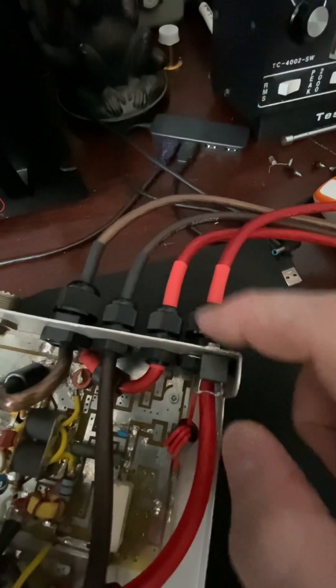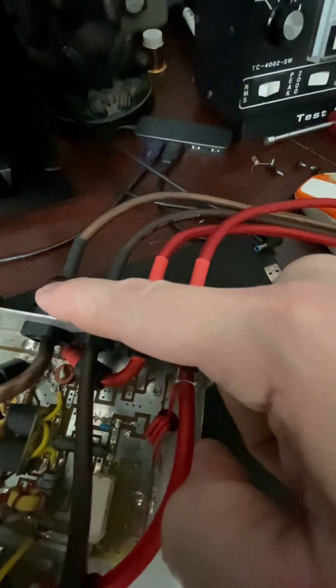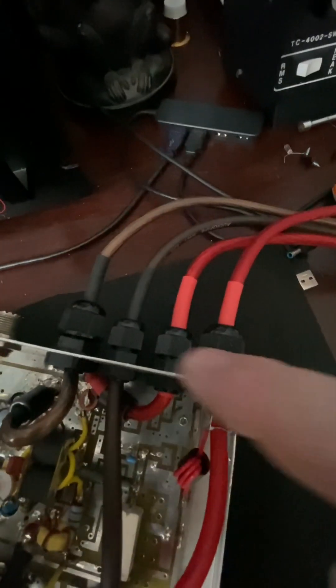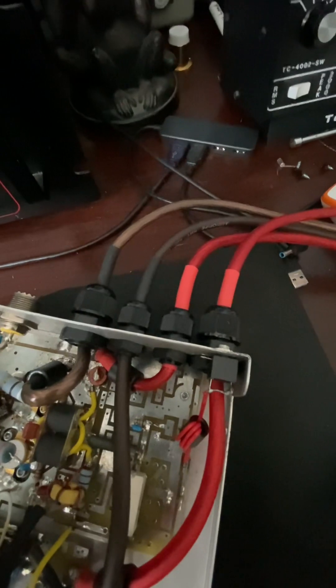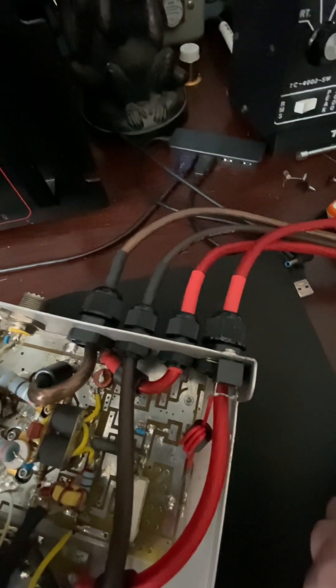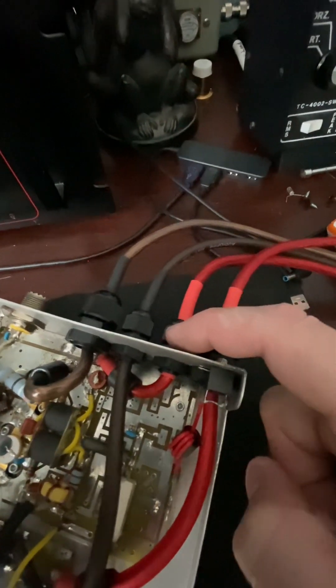One of the other things I did: when I put these grommets in, this is 8-gauge wire. I went with the 8-gauge grommet but I couldn't get four of them in there, so I'm actually running with two of the 10-gauge, which worked just fine. If I had known originally, I would have just done them all the same way — 10-gauge. But the 8-gauge wire does fit inside the 10-gauge grommet.